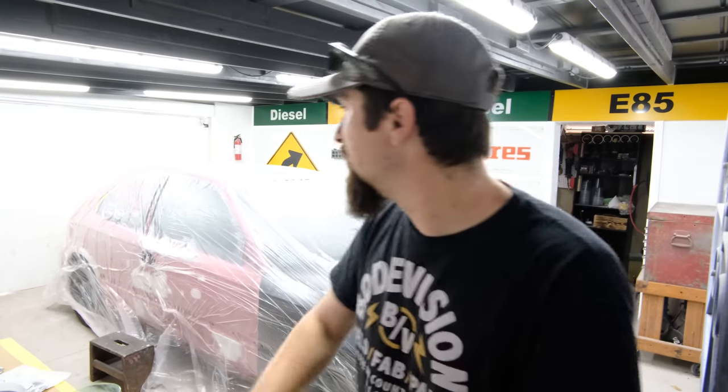Now I'm just going to sand down the roof. I'll probably sand it down with a 180, and then after it's sanded down, I'll come back with two coats of primer, just over reduced a little bit, so that way I can spray it out a little bit smoother. It'll lay out nicer, and I can just do one coat, wait a minute, then do another coat after that. So in the end, I will still have a nice thick layer of primer to work with to smooth out this wavy roof.